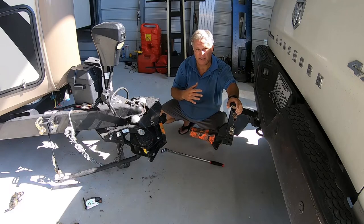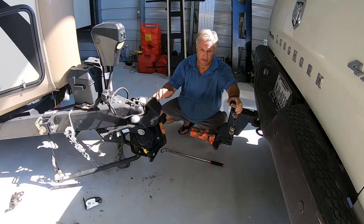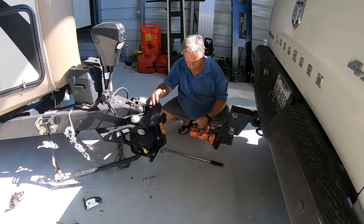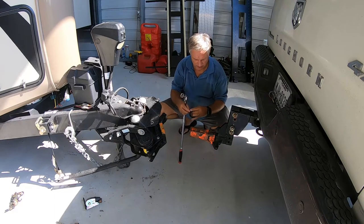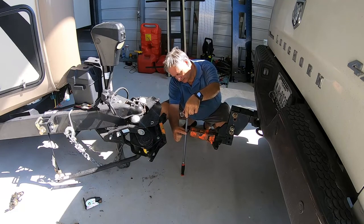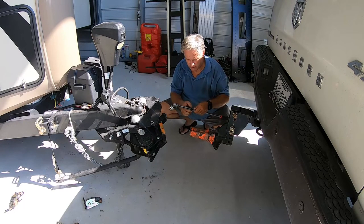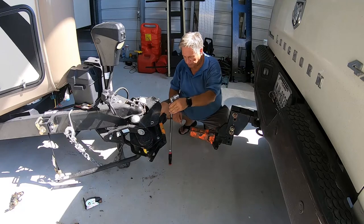Here's my method to make it simpler. I'm going to show you how to set it up so that every time I back my truck into storage, it's going to be the same measurement for my trailer height. I take a bar and a little bit of tape, put it up against my hitch and figure about halfway, then put a little masking or electrical tape there to mark it. Now every time I'm hooking up from my garage, all I have to do is raise my trailer up to match that mark.